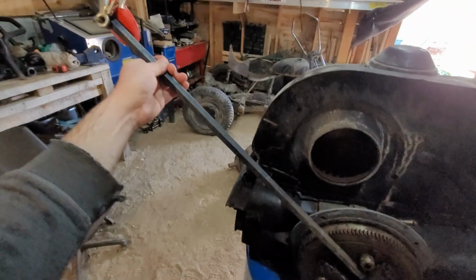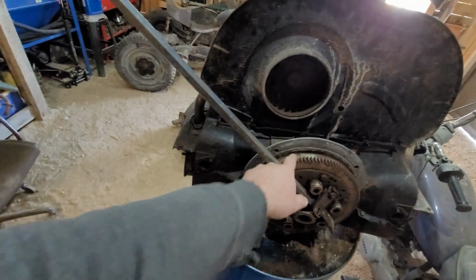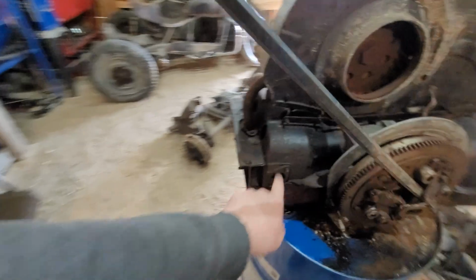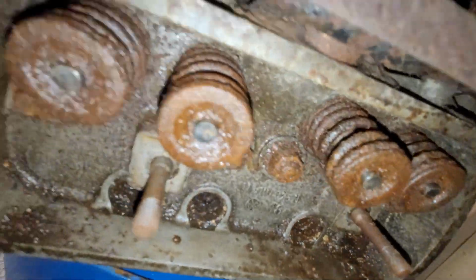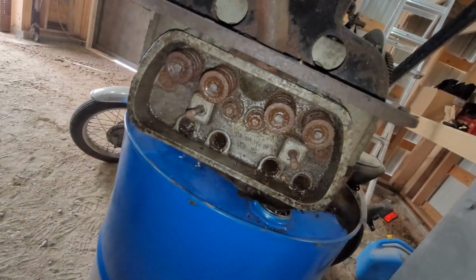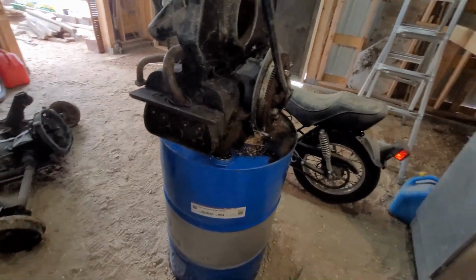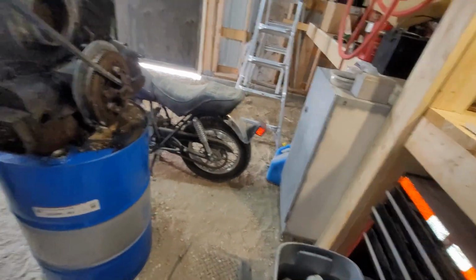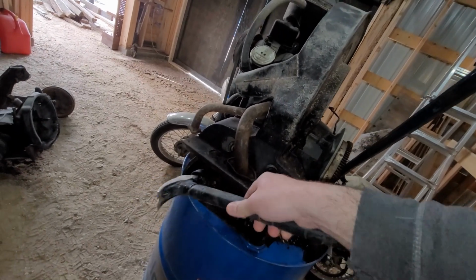No pressure on that no more. And yeah, it hasn't moved off my mark. So, I'm still guessing it's this side because the valves are that crusty and rusty. Look at that, hey? The two there, or 2 of them were stuck. I don't know if actually they popped out. Not a big deal. They're shot anyway, but yeah, it's the 2 exhaust valves that were stuck.